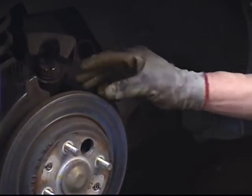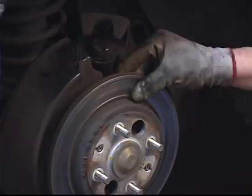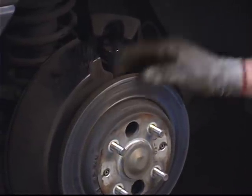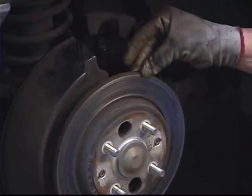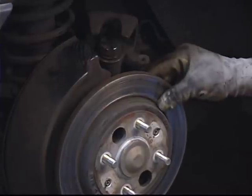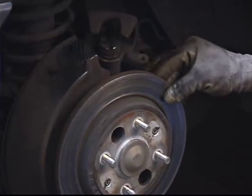Either way, it's an extremely hazardous and bad situation. So it's really important to keep the rotors within their serviceable tolerance levels, and each time you replace them and put new pads on, they're re-machined so they're perfectly smooth again and flat.